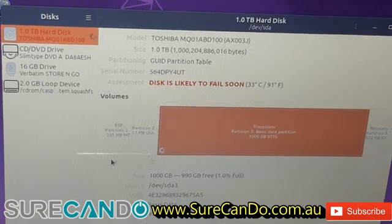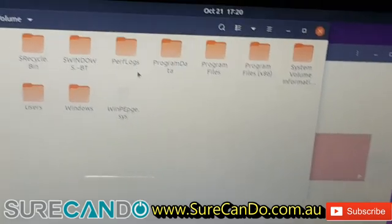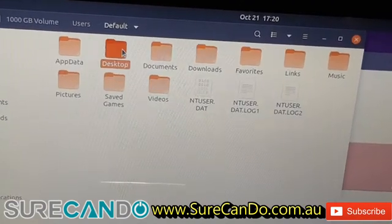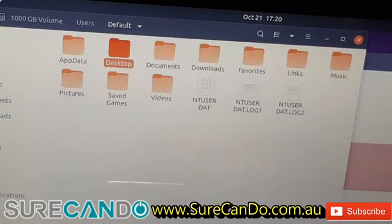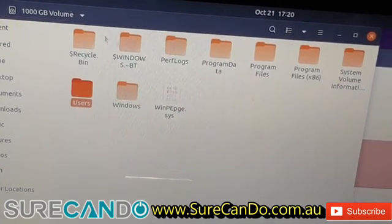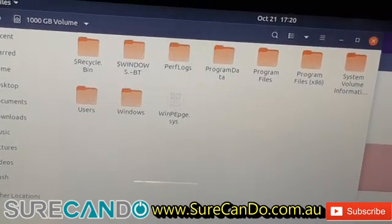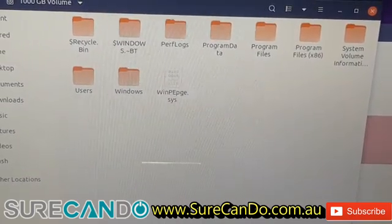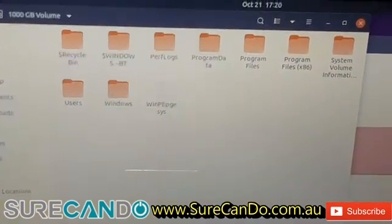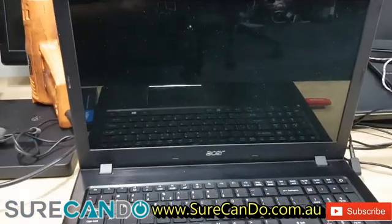Let's see if we can see the files anyway. Yeah, we can. Fantastic. Cool. You know what? Normally I wouldn't bother with cloning a failed hard drive, but in this case I'm going to give it a go, and hopefully it will finish properly. For the cloning, I'm going to use Macrium. So let's shut down, install the new hard drive, and then boot from Macrium and clone it onto an SSD,